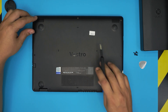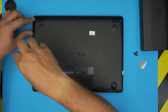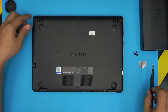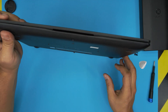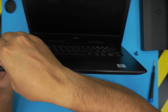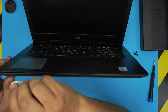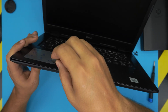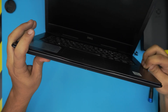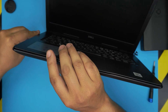Now remove the rest of the screws. When you get to the corner c-lock screws, just twist until you hear that click and let it go — same thing on the other side. Once you've loosened them all, open the laptop a little bit and stick the guitar pick between the top and bottom cover. Start from the left side, twist, and you should see it opening. Work your way along the front, then go to the left and right sides and all the way to the back corner.